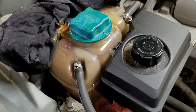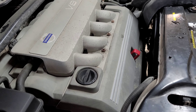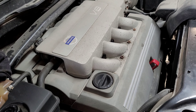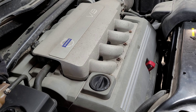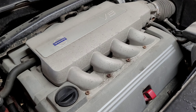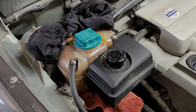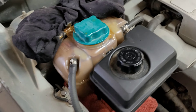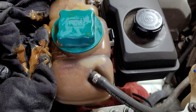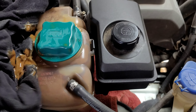If your coolant tank or overflow tank looks all brown and sludgy and is overflowing, you may have the same issue. I started noticing my low oil light came on shortly after I had just changed the oil, so I knew it was at the correct level. I checked the oil level and sure enough it was a little bit low, and at the same time I noticed coolant leaking out looking brown — clearly oil is getting mixed into the coolant.